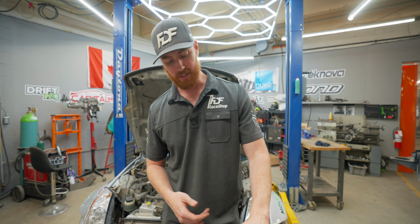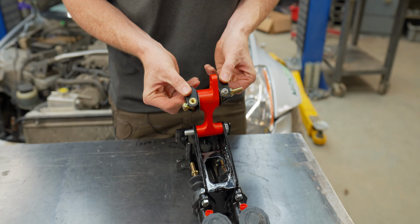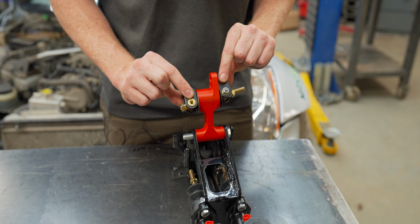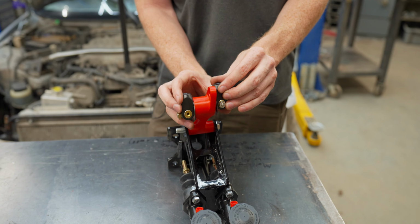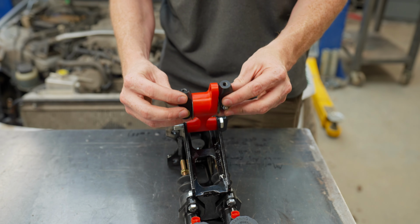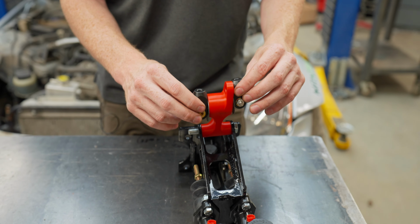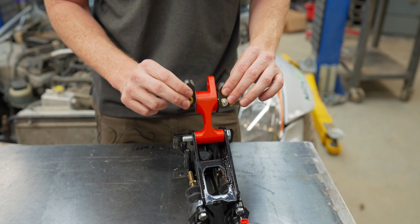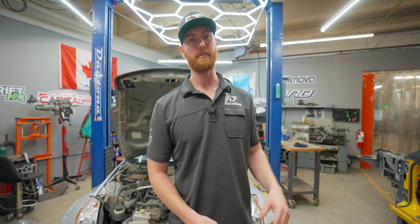And if you push it hard enough, like I was saying, this bearing has articulation, and you can see that it can only move so far. So you can only ever do this much pressure towards the driver's master before you actually hit bind, and then you just start applying the same amount of force on both. It's really only going to do it for the first half an inch to an inch of throw, which is usually enough to apply a lot of force to a brake caliper.